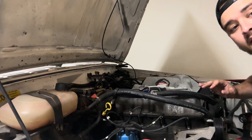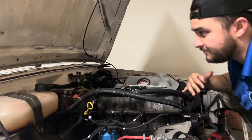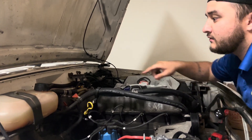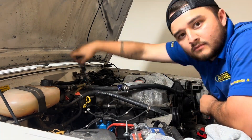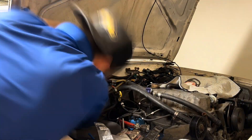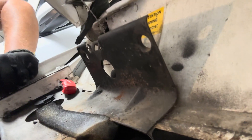It's a different day now and I'm going to start removing this guy because my radiator is coming in tomorrow or the next day. I'm also removing these hoses that are still connected, getting rid of the little valve, the T-fitting, and all that other stuff to get it ready for when my parts arrive. Everything came off just fine except for the two hoses directly connected to the heater core — I tried wiggling and prying them off but they were just stuck on there, so I cut them off with a razor blade.